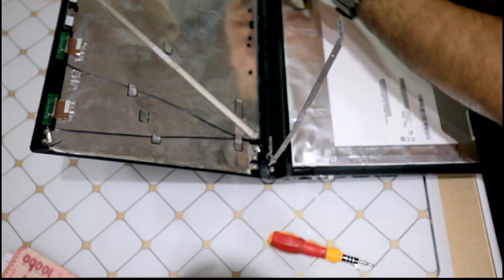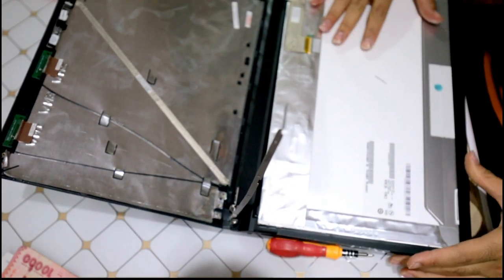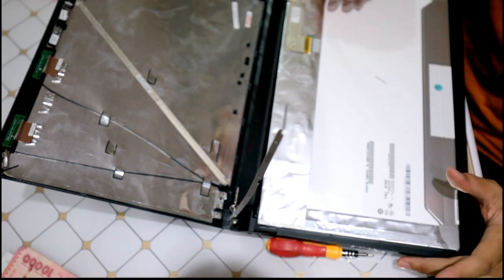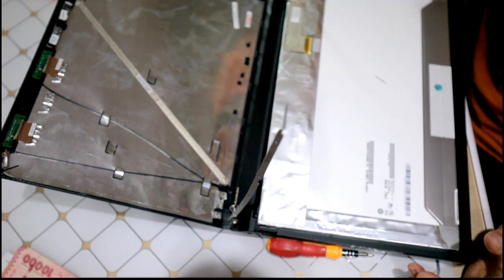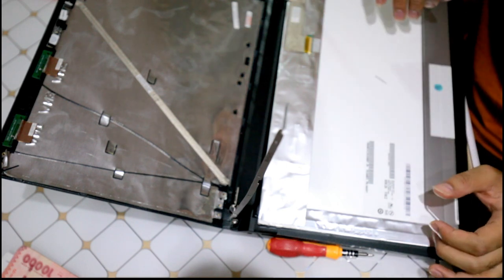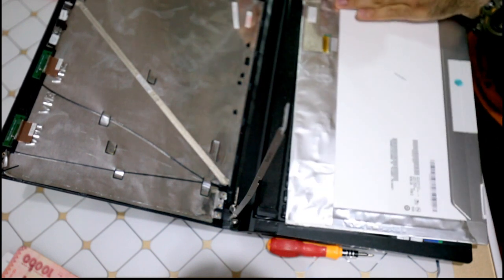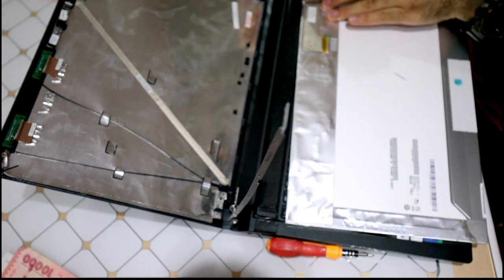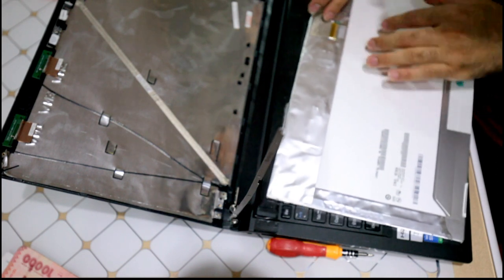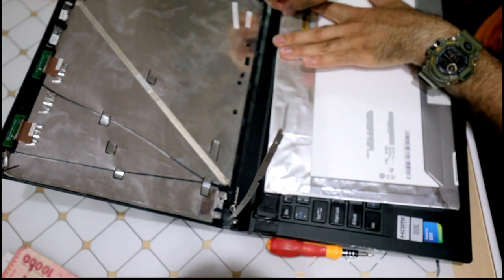Also, this is the connectors here. It's very, very important with this sort of sensitive electronics. And never touch the connectors on either sides, because it doesn't matter how clean is your hand, the smallest sweat or oil from your hand on those connectors would cause issues. Now, you can see there's kind of a double-sided tape used for these here. And now, slowly work our way.